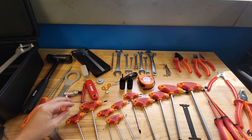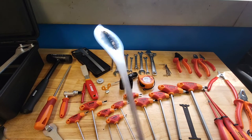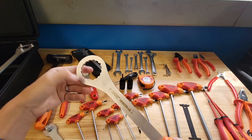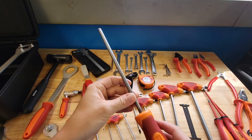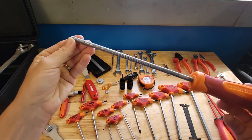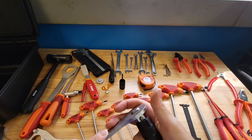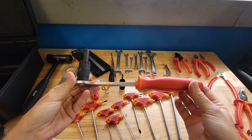There's a bottom bracket and disc brake lock ring tool — the typical external 16-notch bottom bracket tool. There's a round file, which could do double duty compared to a flat file. There's a dental pick, which is a nice touch. And there's a half-inch driver that your cassette tools can go on, so you can also get sockets if you wanted. Kits are always a sort of compromise.